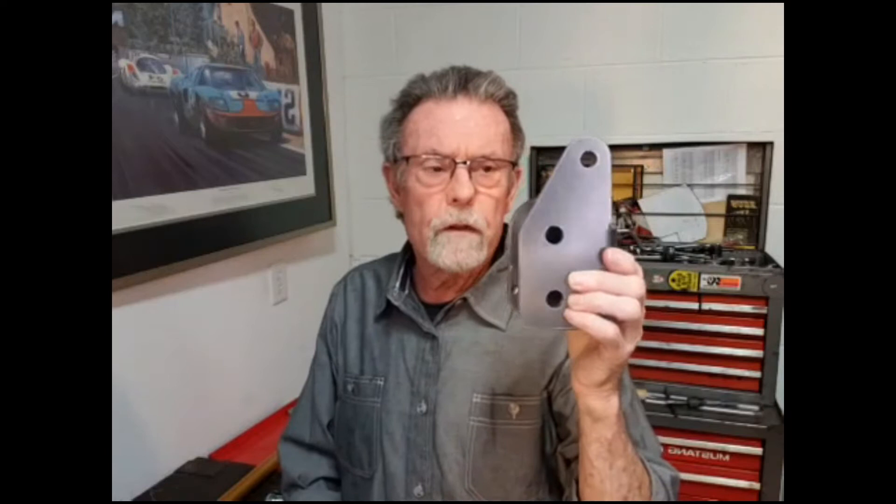This is the traction lower — the grip bracket — and what it does is move the pickup point for the control arm four inches down. By moving the upper and lower pickup points down, it brings the instant center — which on a lowered Mustang sits way out in front of the car — all the way back toward the middle of the car. That gives us good anti-squat geometry, and anti-squat also means anti-lift, so it holds the back of the car down under braking. Anybody who's hit the brakes hard on a stock Mustang knows how badly the rear wants to jump up.